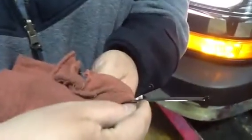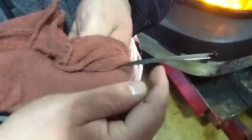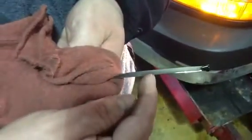Transmission fluid is very clean on this one. It is at this level here, which indicates that it is full when hot. Since this engine is hot, it is in the hot area, meaning it is full. There is a cold area in case the engine has not been running. That's where it should be if nobody's been in it before you.